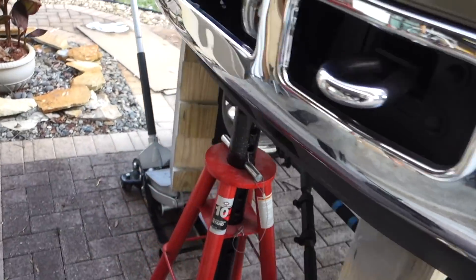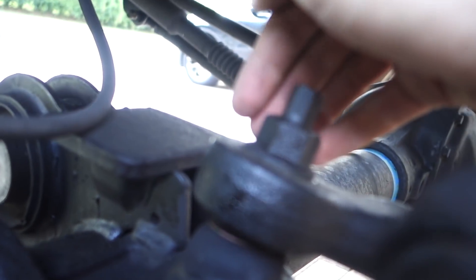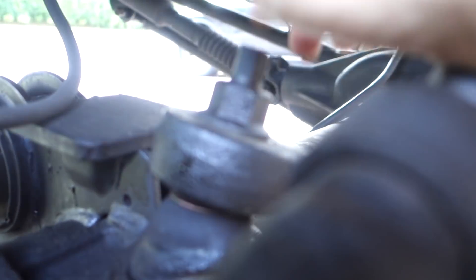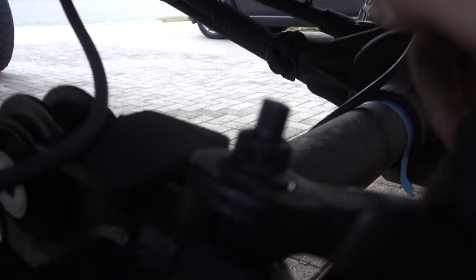I also found something else which I already know is a big reason I had death wobble. This bolt right here — it won't focus — but this bolt is the track bar. Track bar goes up. I have it disconnected right now. This is loose — it's actually loose. I'm not going to be able to do this right now. I'll show you later, but my track bar is loose, which is probably why I had death wobble in the first place. Fixing the geometry of the suspension and tightening that nut should fix the death wobble completely. I'm out of breath — this was a lot of work. I have to run to Home Depot and buy two more long bolts because my old four-link brackets only use three bolts and this one uses four.